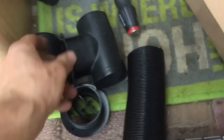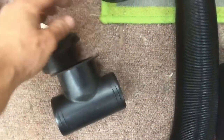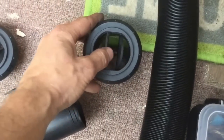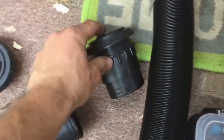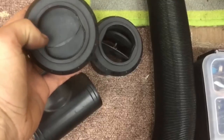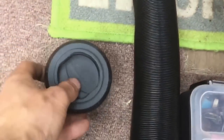Other things we'll need for the installation are connectors and vents. Here are some T-connectors I'm going to use — this one here is slightly different and enables us to screw a vent into it. It's worth noting that the Eberspächer and Webasto parts are interchangeable; anything that uses 60mm ducting is fine. These vents here are 60mm Webasto ones — I opted for these as their appearance is a bit better, they're fully closeable, they click shut, and they have a really slim-line profile. I believe they were also a few pounds cheaper than the Eberspächer ones.